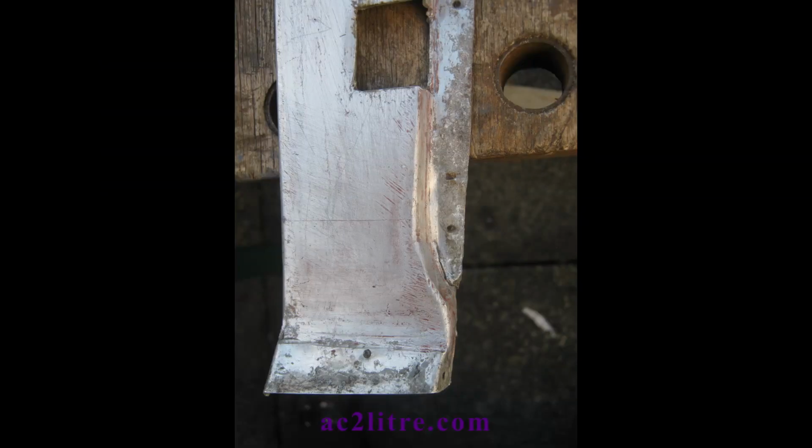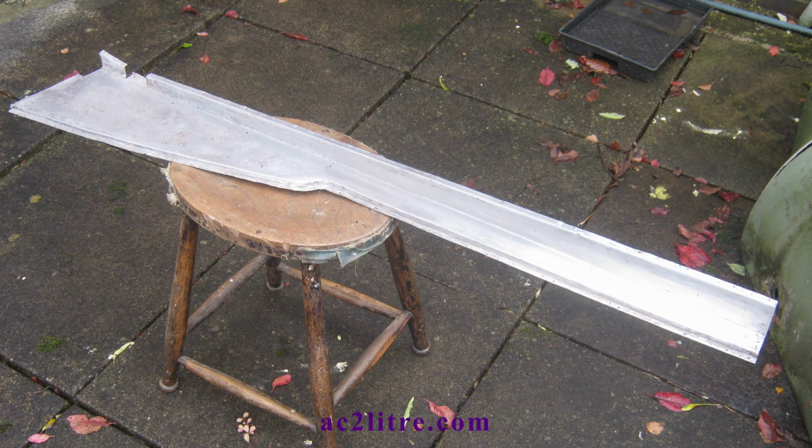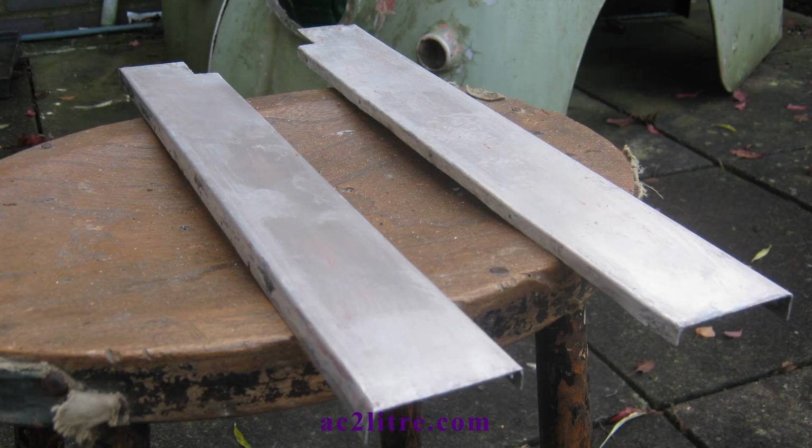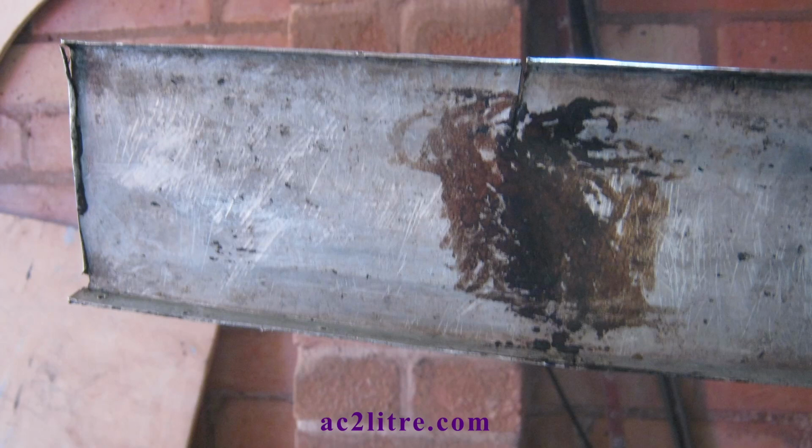This panelling is made of duralumin, left over from World War II aircraft production. It's an alloy that was developed before World War I and is known as an age hardening alloy. That is, after heat treatment it slowly becomes harder and stronger over a period of hours, weeks and even months. When it is slightly work hardened in the course of making panels, its strength is comparable to mild steel, but only 1/3 of the weight. Annealing will reduce the strength as well as the hardness.